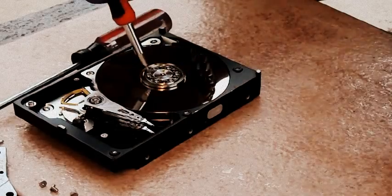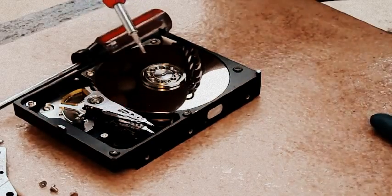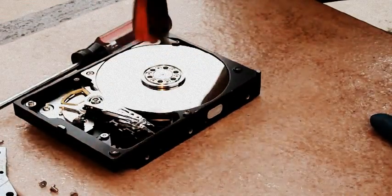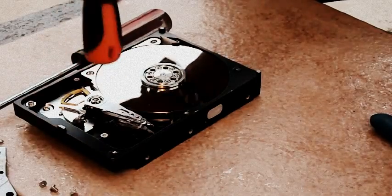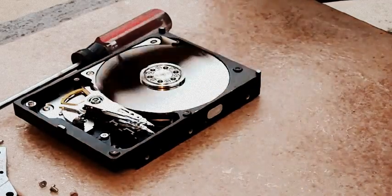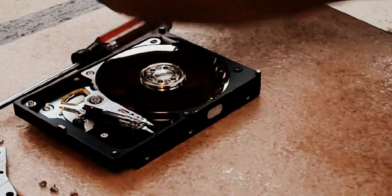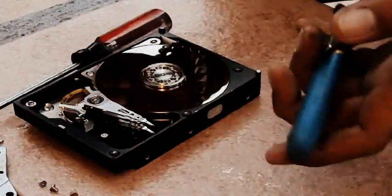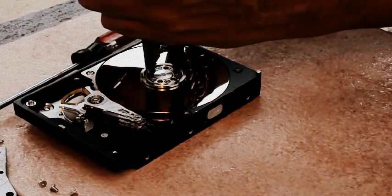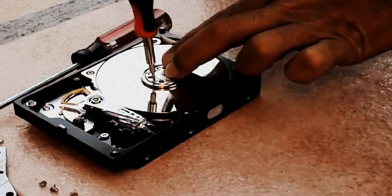Here, first of all, you need something so you can hold on from here. You've got six holes and six screws here. You need the proper equipment for working inside the hard drive — you need to buy a kit, a hard drive repair kit for that. I tried to pull out the screws with this improvised tool, but it's a bad idea because you can damage any part at any moment. If the screwdriver drops off and scratches the disc, forget it — the hard drive won't work anymore. But I used it very carefully and pulled out the screws.